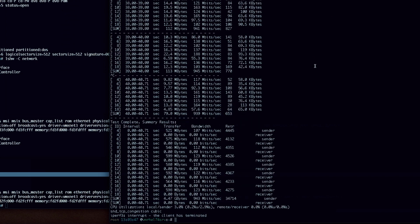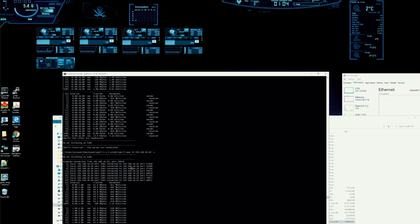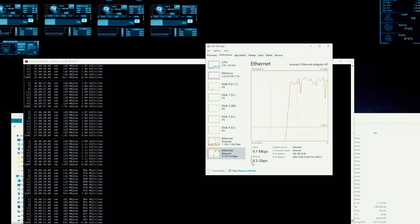Again, we can also check iPERF for the previous connectivity. If we do it again on the Linux system and start driving that, the throughput again is showing 8.9, but the most interesting part is the network graph. You will see that it's driving 8.7 gigabit per second, which is exactly what this card is supposed to do. When the speed test goes, it goes like that. But when I move files around, it's going to be slower because my current NAS doesn't have cache, and that's why the speed is going to be impacted. In general, the first thing you do once you install the 10 gigabit cards is run iPERF and validate that your infrastructure is running correctly, and you see at least 8.79 gigabit per second on your tests. It should be more or less consistent. You see some dips here, but in general you should be above 8 at least.